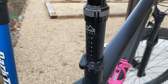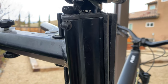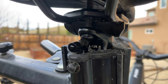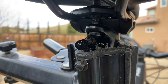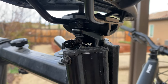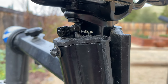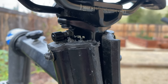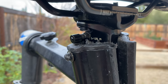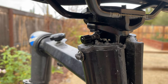As far as tuning the shock within the post, there's a valve right up here at the top just under the saddle, and you just use a regular suspension pump — just like you would on your shock or fork — to adjust it. The pressure range is 230 to 300 psi. Unless you're really on the light or heavy end of the rider spectrum, just start in the middle of that range and make fine adjustments from there, and it shouldn't take any time at all to get this working really well.